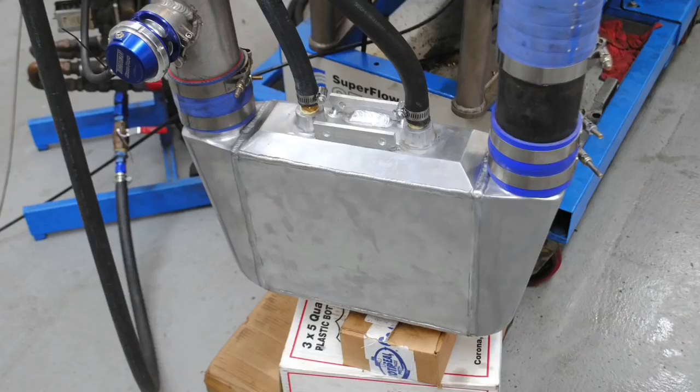We have a turbo LS — not just any turbo LS, it was a very cool short-stroke big-bore turbo combination. Here's what we did: we were running a turbo LS with an air-to-water intercooler and all we did was eliminate the water flow through the intercooler core to raise the charge temperature and decrease power. You can take this information and apply it to almost any forced induction motor of any kind.